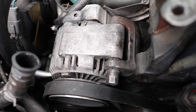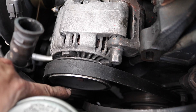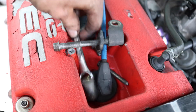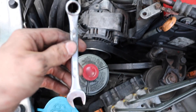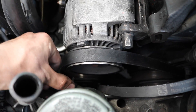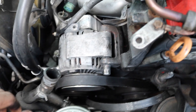Okay guys, I'm on the final steps. The bolt, or the nut, that was down there under the pulley, is this one — it's a 12mm. I ended up using this little wrench, I found this to be the best — tiny little 12mm. Now I have no tension on the belt, so I'm going to take off the belt, break this bolt next, and the whole alternator should drop.